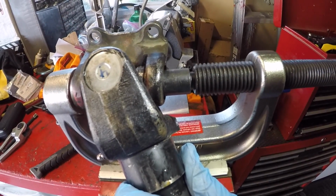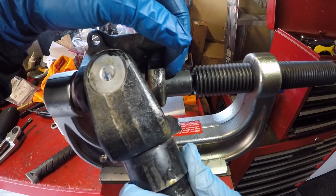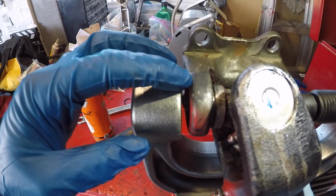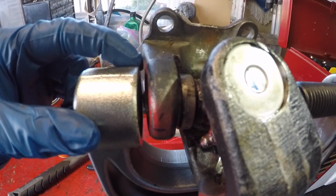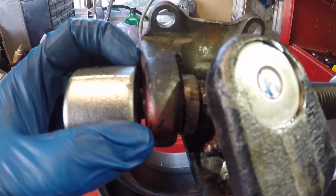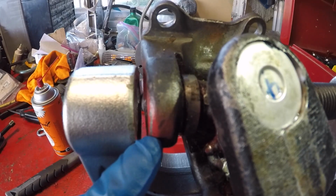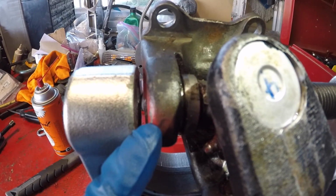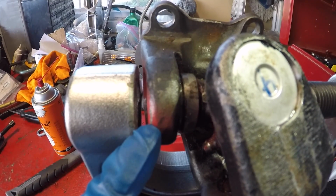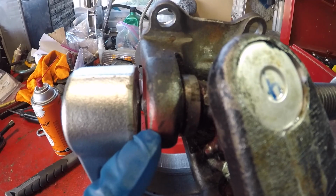What we're showing here is the shortcomings of using a ball joint C-press. You can see that we have this side square against the bearing cup, but then when you look on the other side, because of the way that the yoke is tapered, it's only grabbing on this back side. As you start to turn the spindle and press the cups out, this thing wants to move on you because it's only connected on one little edge. We put little pry bars and screwdrivers and washers in here to help take up this gap to stabilize the C-press, but nothing really worked that great. We did get it done, but it was kind of ugly, and so that's why we're just going to abandon the C-press idea and use a different technique using a 2-jaw puller.